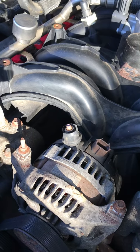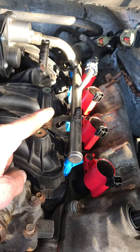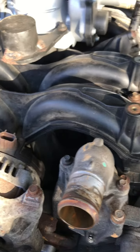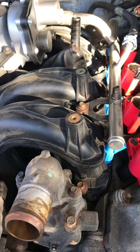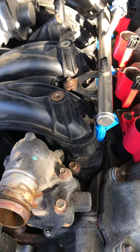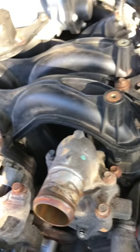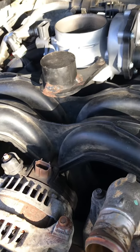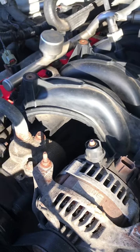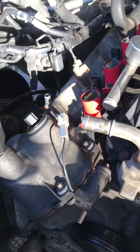Same thing with the water hoses over here. Once I get this out of the way, I need the fuel rails — I'll get them lifted up. I'm going to get down to the intake bolts. It looks like there's only like four per side. I can't really tell — four and then one here and then one here, so it's six. It's possible back in the back, I don't know. I'll actually have to go over and look at the other intake. I can do that just by looking at my videos and my photos.